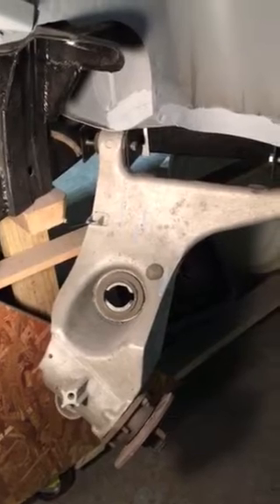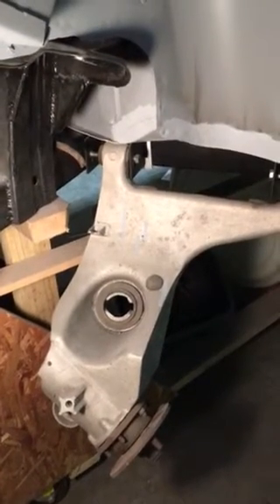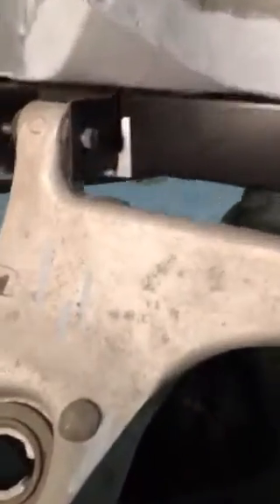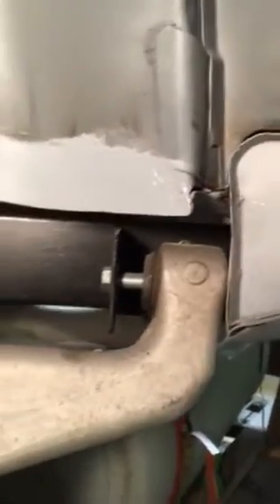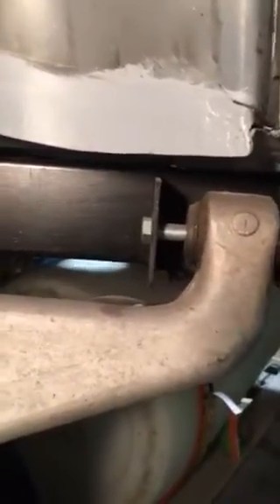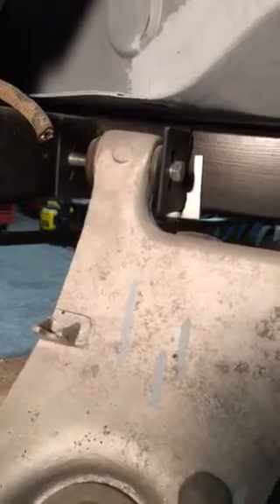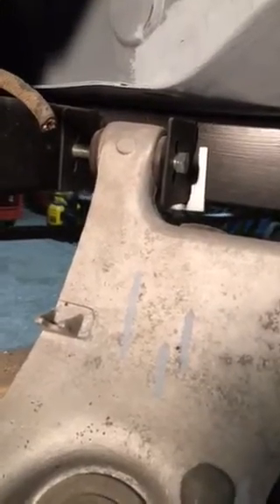This has a restored frame on it, and what I do on a restoration is I make my own temporary brackets. I make them so that there is an adjustment left and right, and I also make the hole in the back large so that this trailing arm can be moved into position when the car is finished. Then, depending on what the outcome is of the adjustment, I make permanent brackets to suit the car.